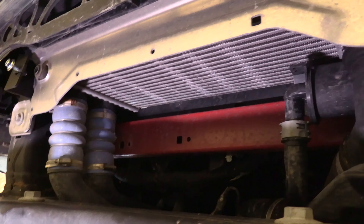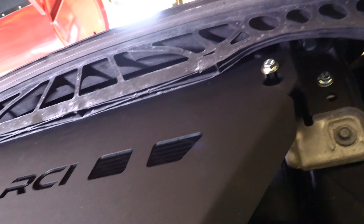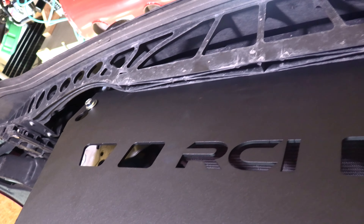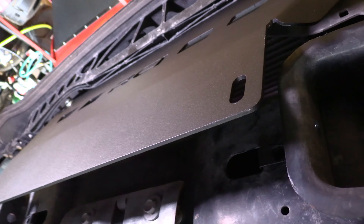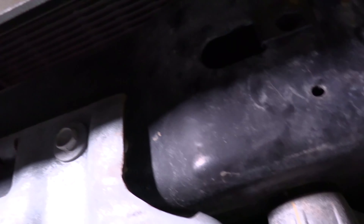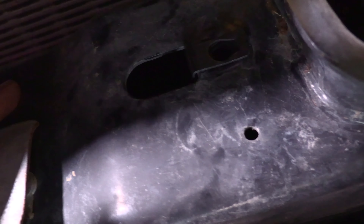So we're going to hang the front plate. We've got the plate on — when you're putting this on upside down, you just want to work one side in underneath that air dam plastic piece going across. Then you just want it hanging by that bolt right there, and then get the other side. So now it's just hanging, and now we're going to fold it back in — it's going to go right on that speed clip right there.